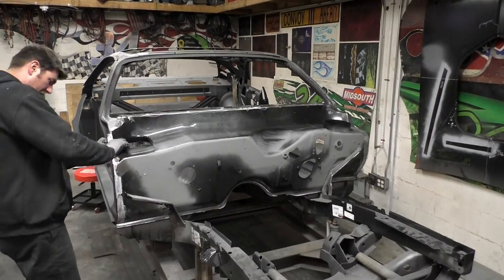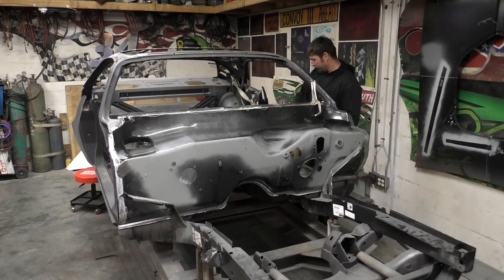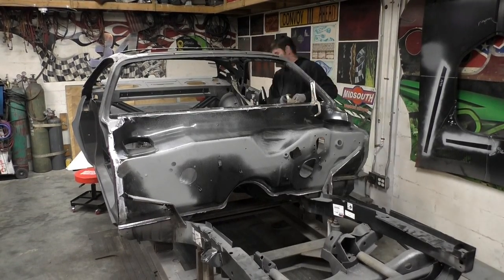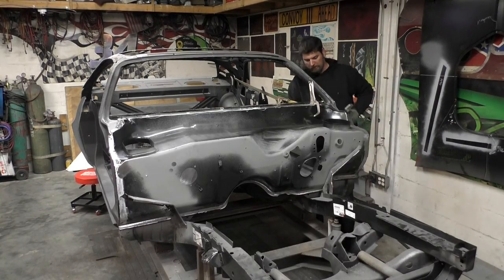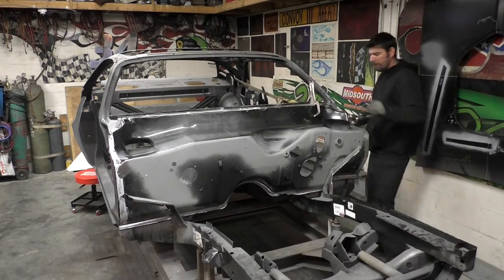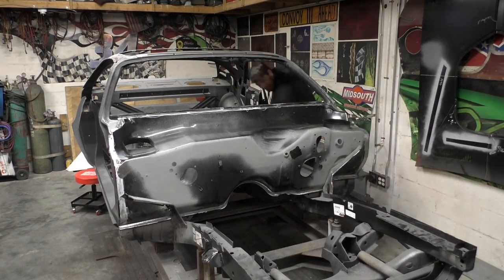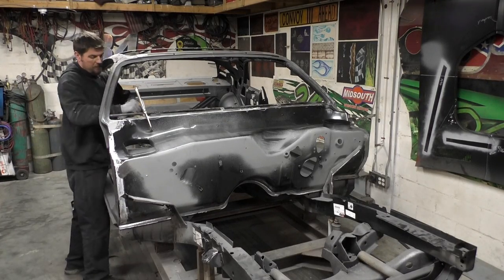The installation of this firewall — same way it came out. You see we walked it right over and set it in place. The top needs to roll back right now, so I hooked a pair of vice grips on the top and you see we're on the back of the car on a very strong support. I'm just slowly ratcheting it in place, rolling the firewall back a little bit, and then clamping the front brackets under the A-pillars.